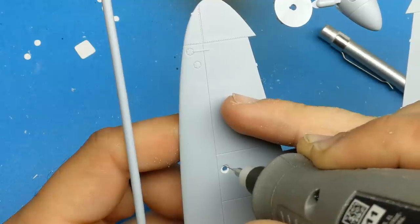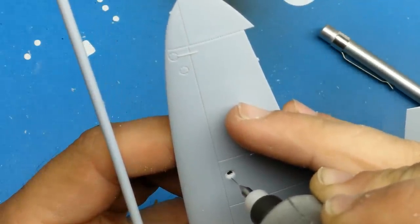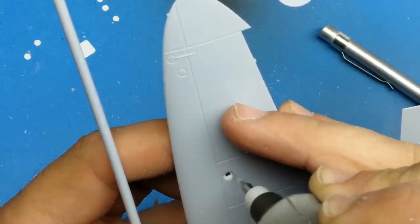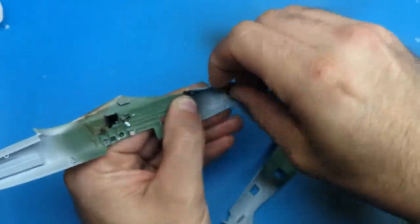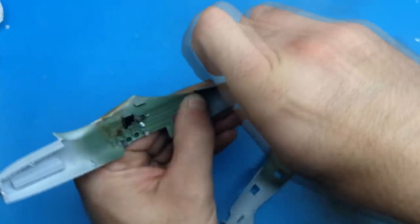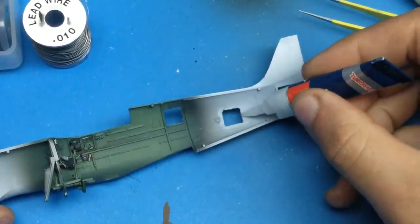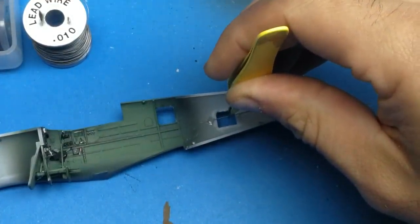While we're looking at wings, the Spitfire Mark 19 was one of the first aircraft to use what's known today as a wet wing - an aerospace engineering technique where the aircraft's wing is sealed so you can actually fill it with fuel. This saved weight because instead of having a heavier rubber or metal fuel tank inside the wing, a section of the wing itself became the fuel tank.